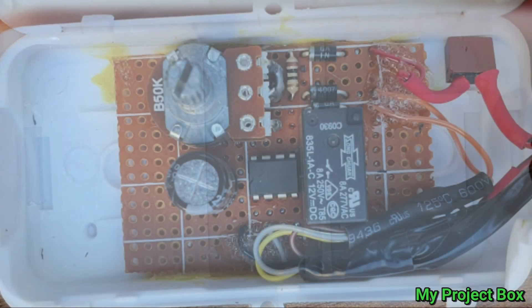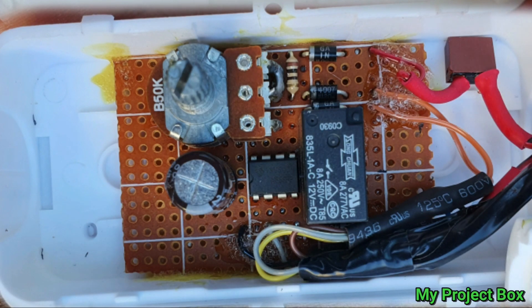After completing the board I used one of these terminal block boxes as the enclosure. I've added a 3-amp inline fuse for the ignition supply, which also passes through a switch — the auto enable/disable for the lights, which just breaks the ignition supply. A 20k trim pot would have given more precision than the 50k pot used, but it works fine. The two orange wires connect to the gray and yellow wires which, when grounded via the relay and diodes, bring the lights on. Those go to the light switch, the ground wire goes to the cigarette lighter negative, and two wires go to the LDR sensor on the dashboard.